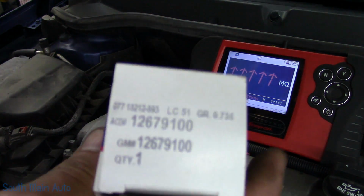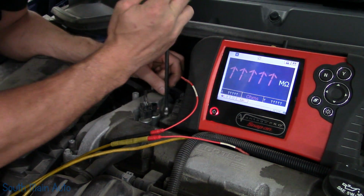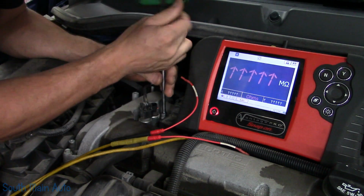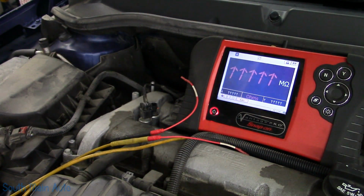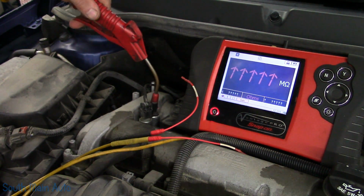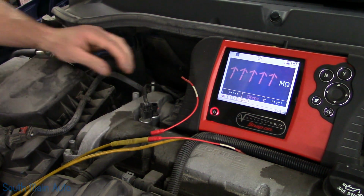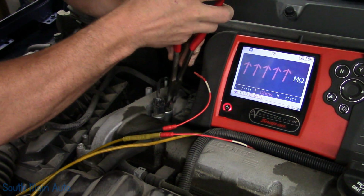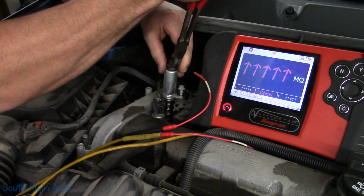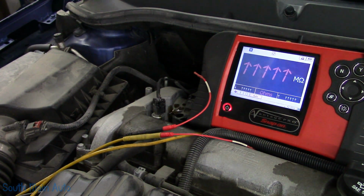And I happen to have one, a brand new AC Delco. There is the part number on it. If you need it, do not buy a Dorman one, unless you like changing parts. So I'll reach in here and just crack the bolt loose on it. And before we yank it out of there, we're going to hit it a little bit with a blow nozzle. Sometimes they can be a little bit stuck. We'll get a pair of pliers. She's hot. Hot, Trinity. Really? Yeah. Toasty.